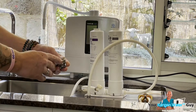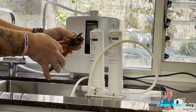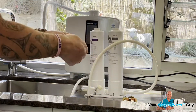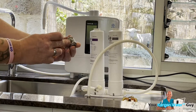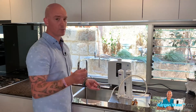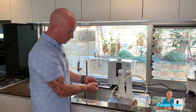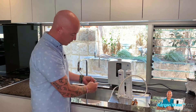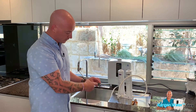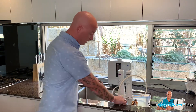As you can see, there's a hole which means the water is going to flow through the pipe. What I recommend you do — and you're probably going to need grips for this, just be careful you don't damage the thread — is just turn it until it becomes loose. Take it out and make sure it's all clear. You can put this on the tap and run your water. I wouldn't advise turning your water pressure on by a lot, but just put it on gently and make sure that when the diverter is set to go to the ionizer, the water is coming out. I have actually seen debris blocked in these holes, and once I've cleaned it out, the water's flowed through. That's why I always say start here.